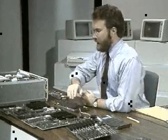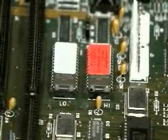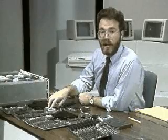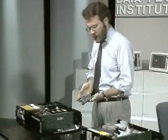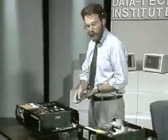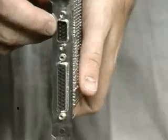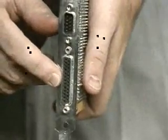Those are both IBM. If we go over to the clone, the 386 clone, notice he's got a couple of ROMs there. See the attractive labels. So in the 386 clone, you see the BIOS ROM here. This is the parallel serial card. Let me just turn it just a little bit so you can read those numbers. If we look at the connectors, it's a male 9 connector, and a male 9 connector, you may recall, is a serial port. Female 25 is a parallel port.